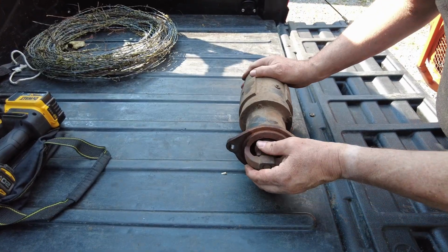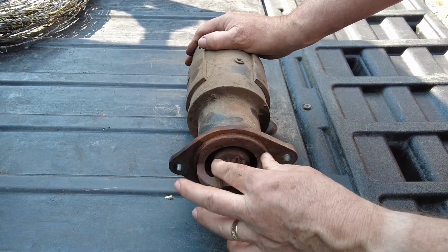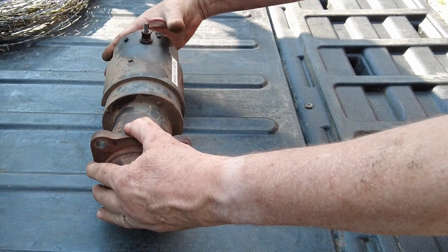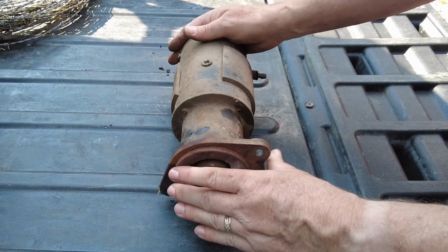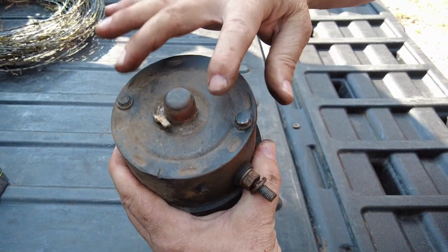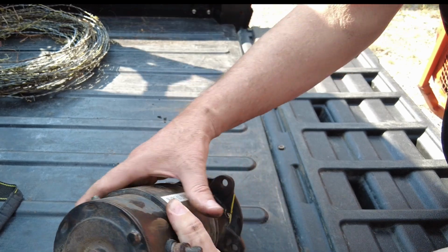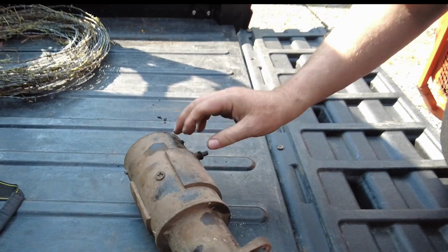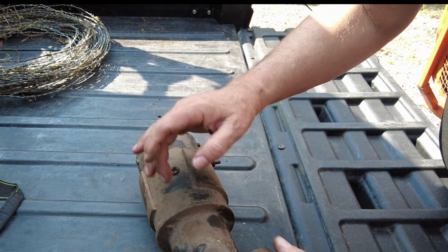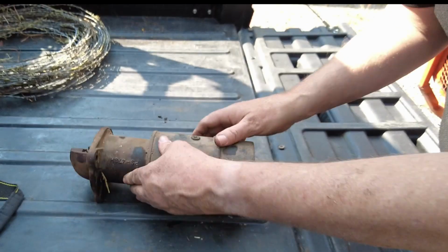Take a look. Yeah, the Bendix is out still, not going back. So this means we need to take it apart. To take it apart, we're gonna have to remove these two nuts here, bolts. Those two bolts, get inside, and then take it off from here, the housing, so I can get access to all that. So, let's start on that.